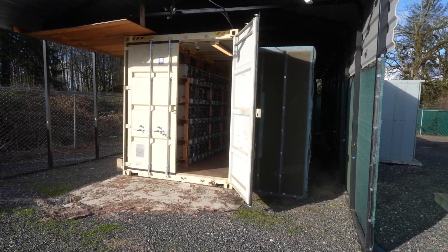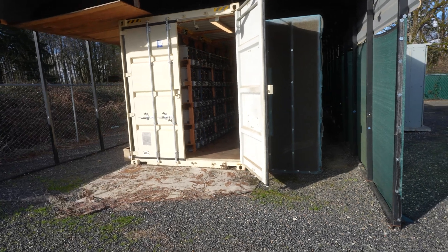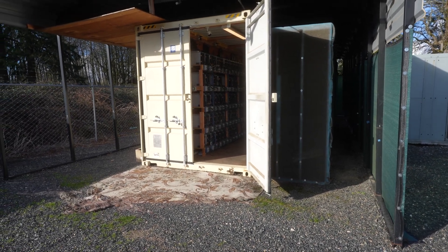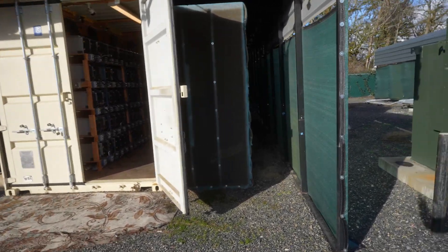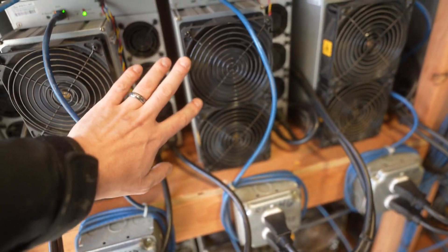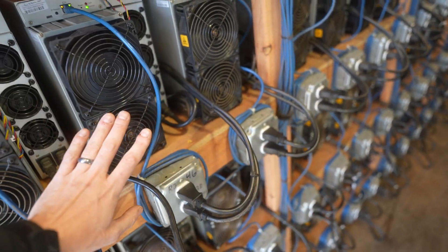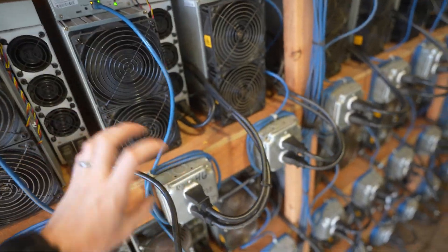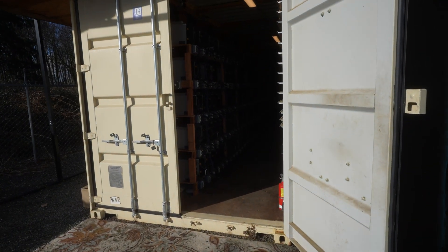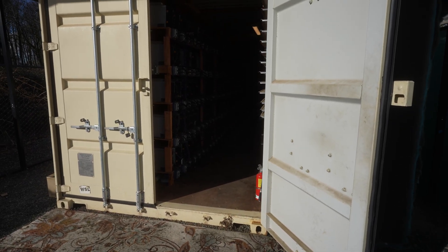When we look at the software, we see fan speeds at 3,000, 4,000, 3,000, 4,000 — and then the fourth fan, out of four fans, is spinning at 800 or 500 RPM. We know for sure that fan is dead. The only reason it's showing 800 or 500 is because the fan is spinning from just regular circulation of air — the funneling of air from the filtration system into the miner is causing it to spin on its own. So a dead fan will keep spinning at 800 just because of the force of air being sucked in by the other fans, but it's not trying to spin by itself.